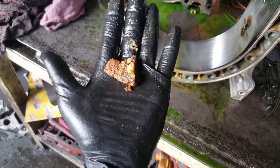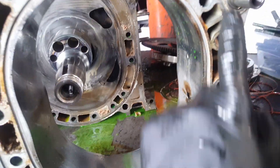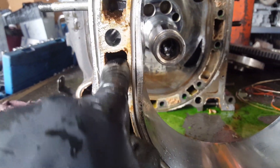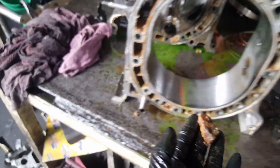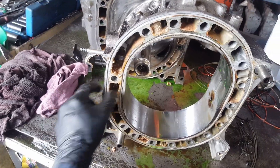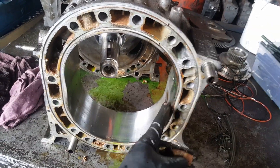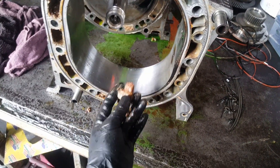This crap is because the owner added some type of leak-stopping product. All it does is block all the water passages — the water jackets. See how it's blocking right there? Look. This is all that little magical stuff you guys buy at O'Reilly's — one of those little bottles that says 'stop head gasket leaking' or whatever. The owner added water because the engine was burning coolant, then tried adding one of those little magical things to stop the leak.